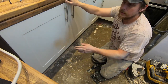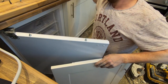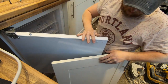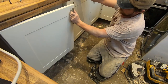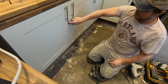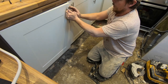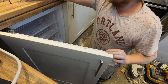That corner needs to come up slightly so take that off, go to the nut, give it a little adjustment, then put the door back on. That's looking pretty bang on. I've got my alignment done with this panel here and the alignment along the top. I need to open the door without moving it to make sure the door doesn't overlap - quite happy with that.